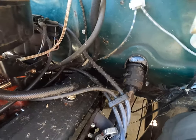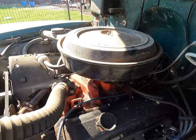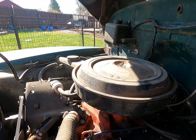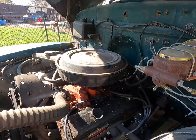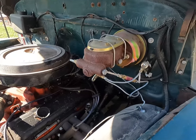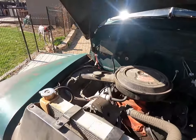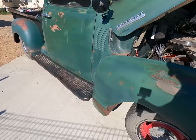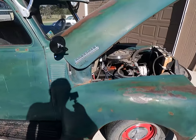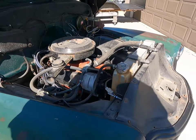If you're inclined to, you could actually lay down and wrap your arms around the transmission — there's that much clearance. This is a 350 Chevy two-barrel out of a 1970 Chevelle that a guy had sitting on his floor — I bought it from him, had it in another vehicle. Turbo 350 transmission. Headers, dual exhaust back to Series 40 Flowmasters underneath it. The exhaust on this is straight with no bends at all — that's how much clearance there is with the frame, and it still sits this low.